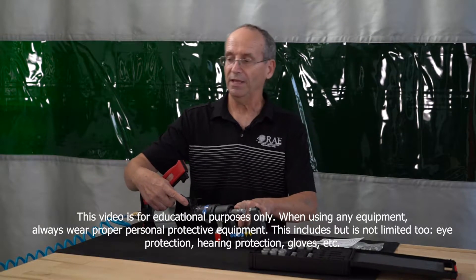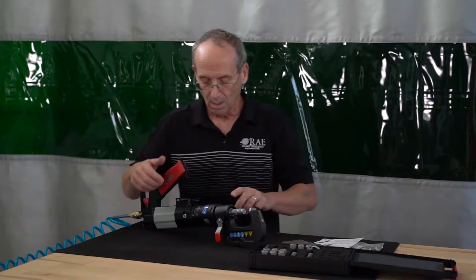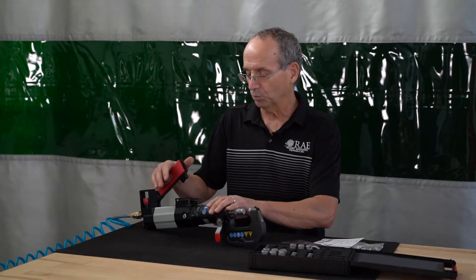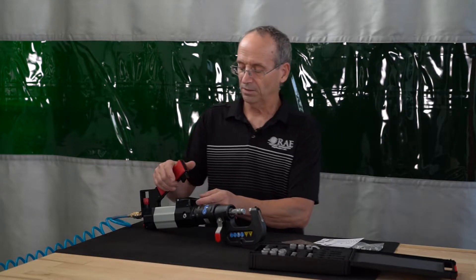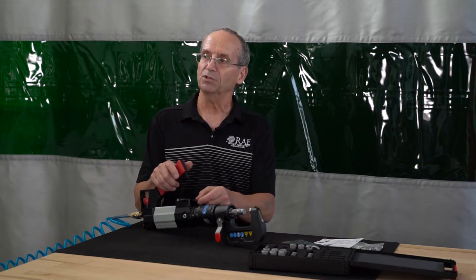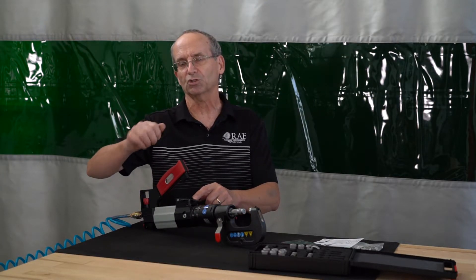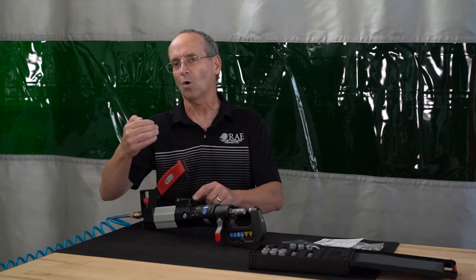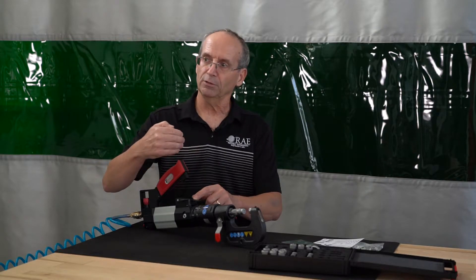Make sure when you've got your hands in here and it's plugged in, this little lever here is flipped up. Usual protocol on this — when you are taking off or putting on the head assembly, this valve always needs to be in the up position. This is basically an on-off valve, similar to a port-a-power. When it's turned on, you have pressure going through and it holds it. When it's open, pressure will not hold on either side.